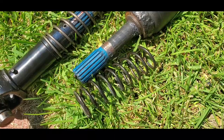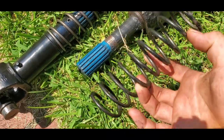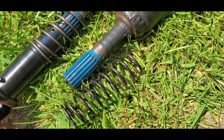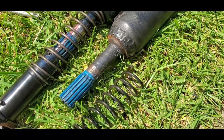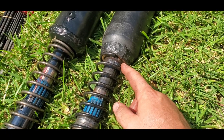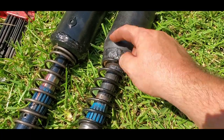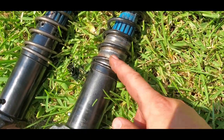These driveshaft slip yokes are cheap and easily replaceable — at least you can get the spring. So if I did screw up I can order another one from Black Magic. But I just cut a few coils off — I think I cut one whole coil off. I'm gonna put that in there; hopefully that'll make it not compress all the way, it won't have the vibrating noise and we'll see if that fixes our issue. I got my cut-down spring in here. As you notice, the nice flat part that seated around this little ring and kept everything centered — that's no longer there. So I predict this kind of unwinding on the driveshaft, but I'm running out of time on this thing so we're just gonna have to rock that and see what it does.